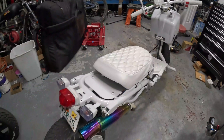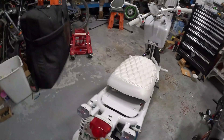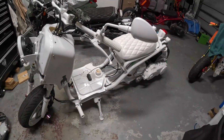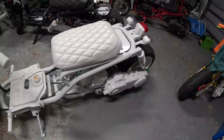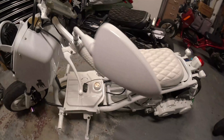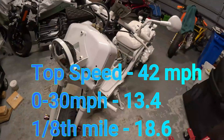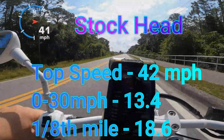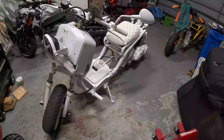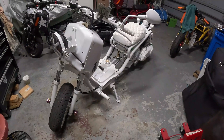When we left off, the bike did worse with the 95mm variator, so I put the stock variator back in. The best results are still with the stock variator, the NCY cam, and the Nibbi carburetor: 42 miles an hour, 13-something in the zero to 30, the eighth mile 18-something, around 9,300 RPM — and it's a 95-degree day. Hopefully we can get more RPM or horsepower and beat those times.